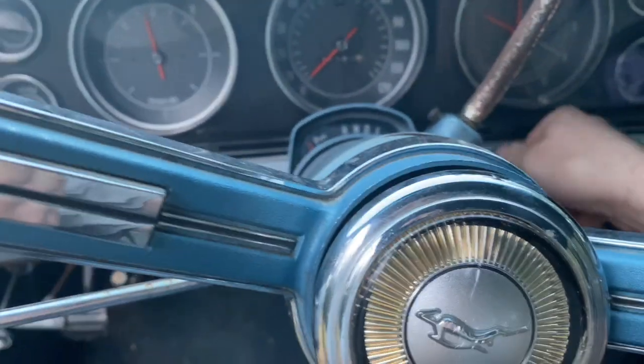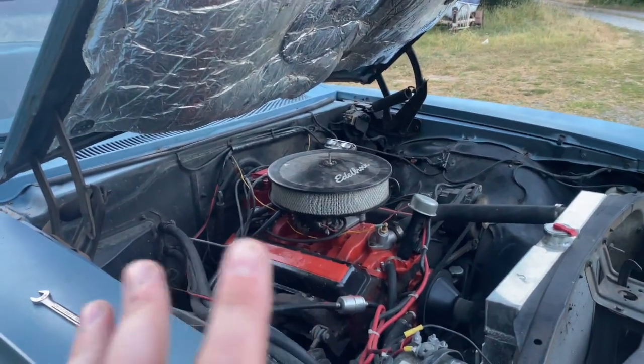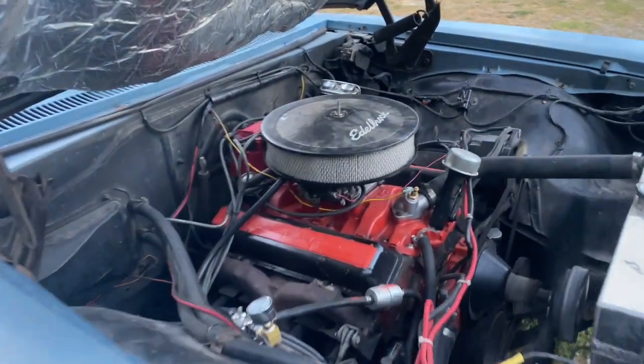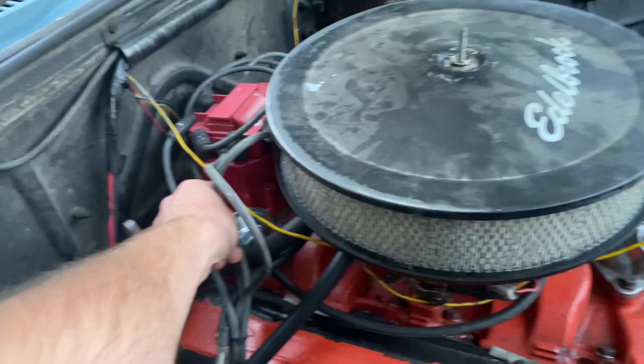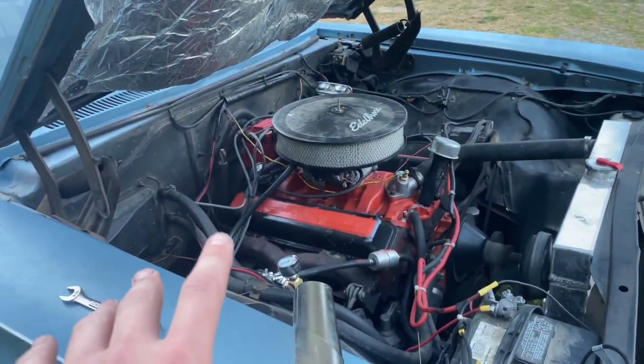You need to make sure your car is running. Ideally you should do this when the engine is at operating temperature. On a lot of road vehicles you will have a vacuum advance canister here — you're going to want to disconnect that. What vacuum advance does is, based on the vacuum from the engine, it will advance the timing a few degrees.